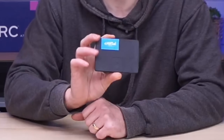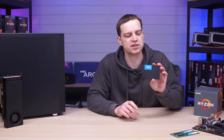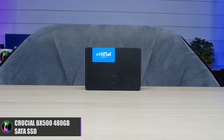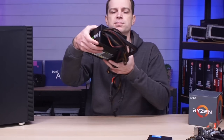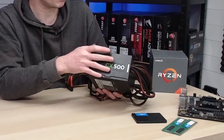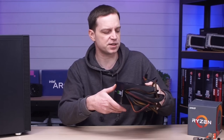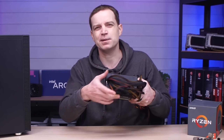For storage we are going with a simple 500 gigabyte SATA SSD. The motherboard doesn't have an M.2 slot so we're restricted to a SATA drive, but we do want to make sure we're using an SSD. This one is from Crucial and really didn't cost a lot — picked up brand new. For the power supply I managed to pick up something decent: a Corsair CX500 500-watt unit. They're pretty decent but not pretty — we've got all this ketchup-and-mustard cabling with no modular system, but it's going to work perfectly fine in this build.